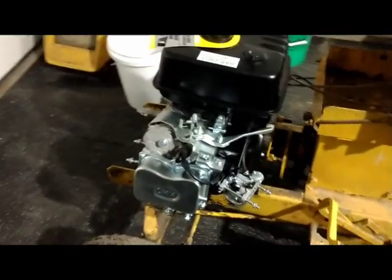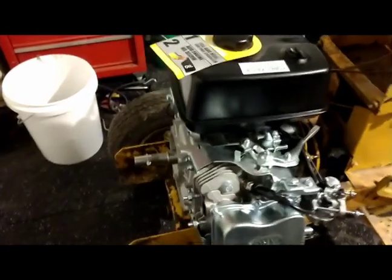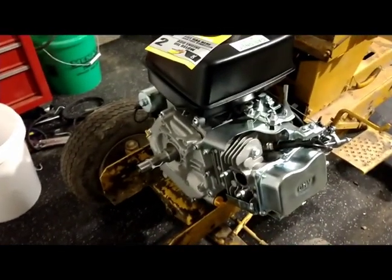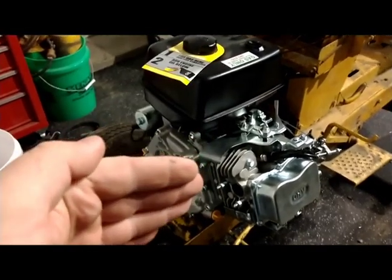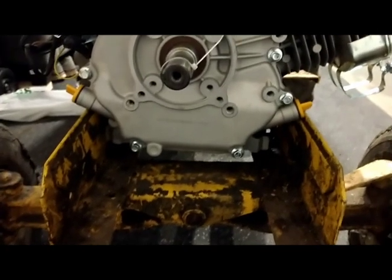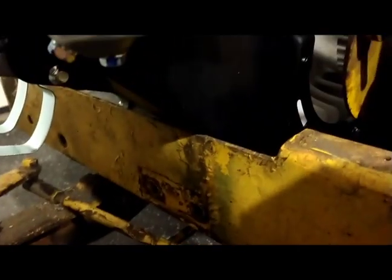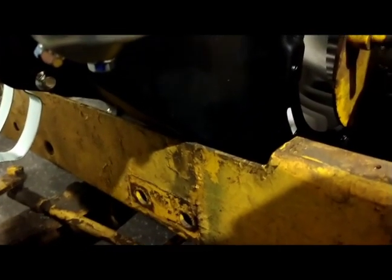After installing the clutch plate, you can see we're not quite ready to drive away yet. The original Kohler engine sat between the frame rails and was a fairly narrow engine with a cylinder perpendicular to the ground, whereas most modern overhead valve engines have this slant cylinder. Both oil fills are contacting the frame rail, so we'll have to notch those out, and part of the shroud is contacting there as well, so that area of the frame will need to be notched out additionally.